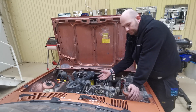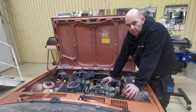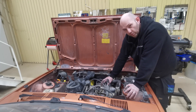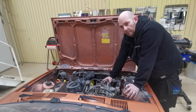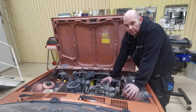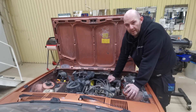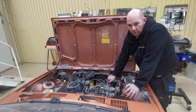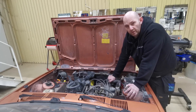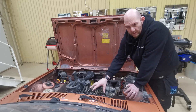Once we've got fuel and air sorted, we also need to get exhaust gases out of the engine. The standard manifold won't fit - it's too big - so we need a custom one. There are people like Shane Baker who make them, or you can get them in stainless steel from other suppliers. It's all about your budget. They're bolt-on items, so you just buy it and bolt it on, job done. You can also make your own by getting a plate that fits the engine, bending and welding the pipework. The one Shane Baker does is relatively cheap, so that's probably the route I'll go.